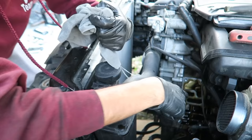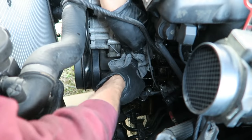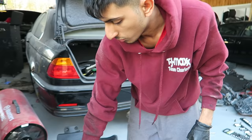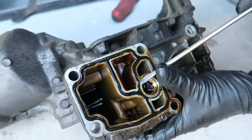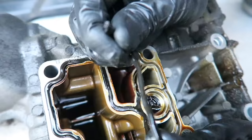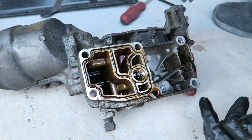This is a good time to clean everything up — you can use brake cleaner or something like that, just make sure you don't get any chemicals inside the actual block. Stuff a rag in the opening so no dirt gets in. Now remove the old gasket off of the oil filter housing by finding the opening. You can see this one's pretty brittle — it wasn't 100% bad yet but it was still leaking. Wipe everything clean and again make sure you don't get any dirt in there.